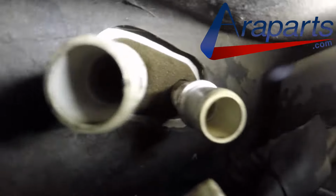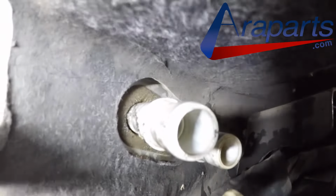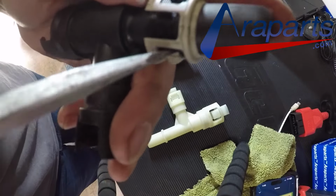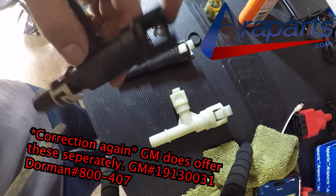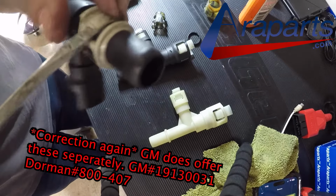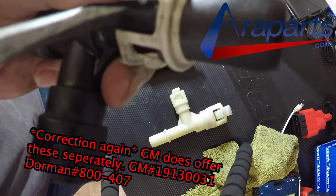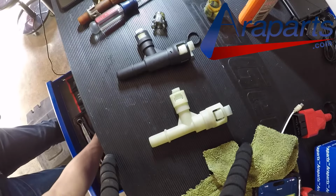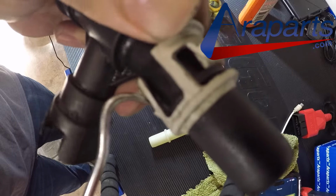Once those coolant connectors are off, we're going to clean the surface and then we're going to start transferring over those clips from the old connectors to the new connectors. Now here's the thing, this is a personal opinion. I don't really think these things were designed to be transferred over and reused. You can do it, but just be very careful with them because you can damage them. They are quite strong. These were 14 years old and they held up very, very well. And they are designed for cooling systems, but you just want to be careful with them.